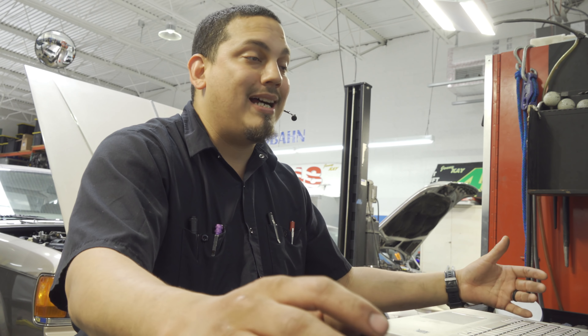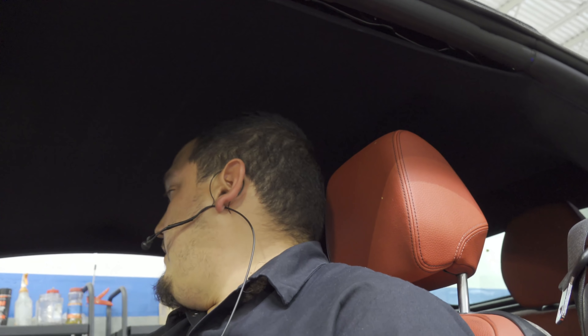It looks like there's no easy way to get at this thing — it's somewhere in this area. At the very least we can put this thing in an emergency open type situation. I want to lower all my windows, turn off my ignition, keep my doors open, and open the trunk. I briefly glanced at the procedure — there are these two buttons here. Pull those and leave them pulled.